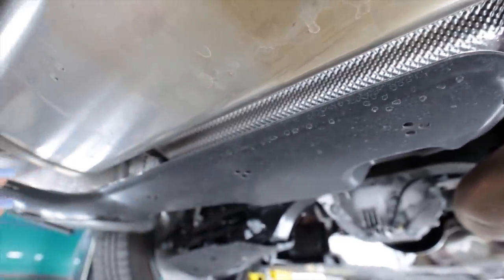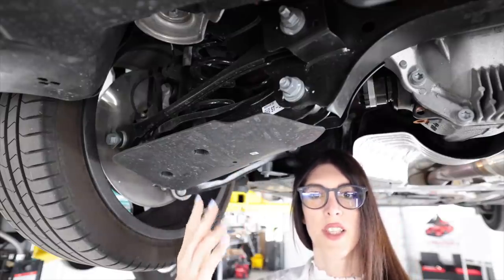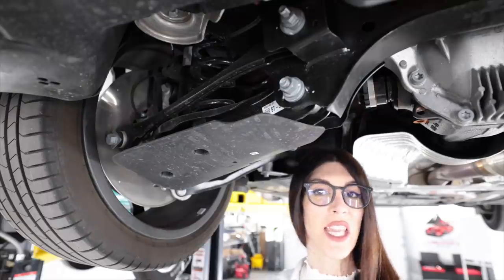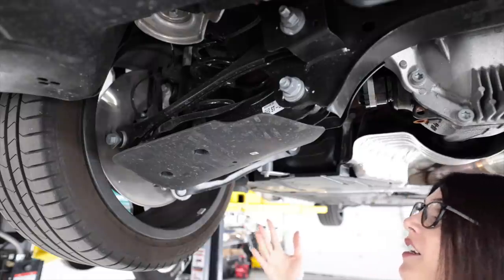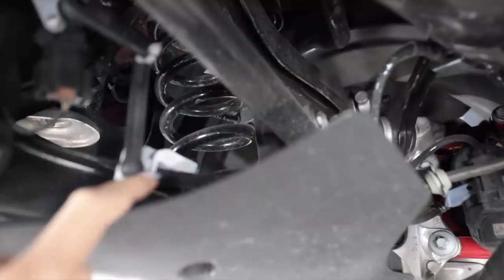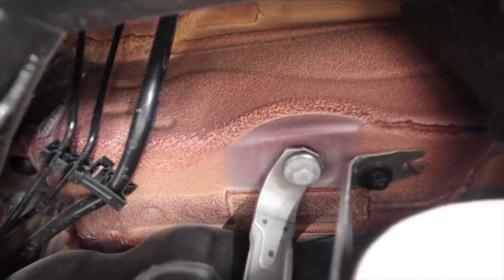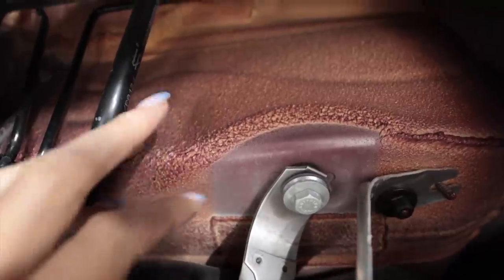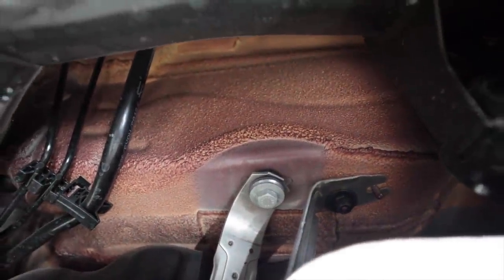There's a little winglet just to diffuse air over the muffler, and another winglet here on the lower control arms. This utilizes a five-link rear suspension — multi-link — and everything back here is steel construction. That is an adorable little spring. Everything back here is really nice. They do undercoat their cars, though they don't use that hot wax injection process like Audi and the Volkswagen Group uses.